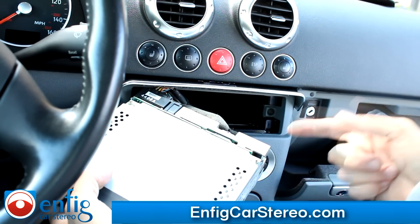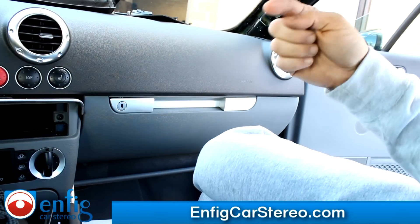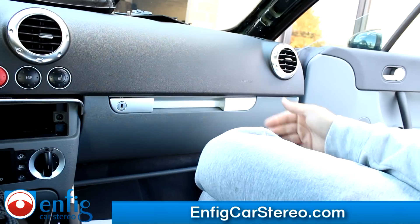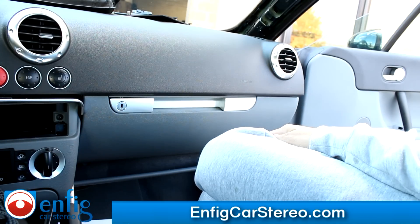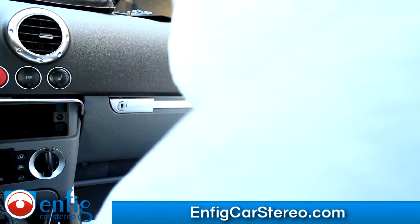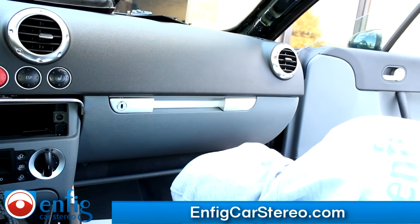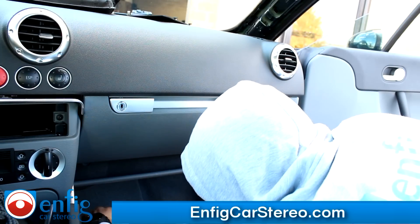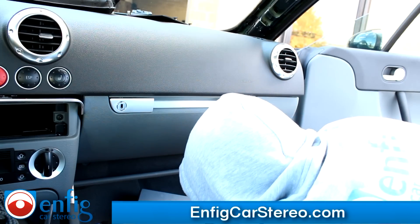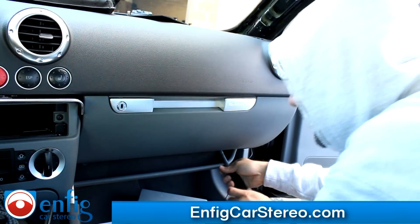Let me go get the adapter and we'll bring it back. Here's the deal — running the cable from that side to this side isn't really super hard, but there's no way to do it that I know is super easy. So I'm just going to drop the glove box — it's decently easy to drop in this car. For most of you it's going to be quicker to drop the glove box than to figure out how to snake that wire. I'm going to grab a T25 — it might be a T27, but I can get away with a T25.